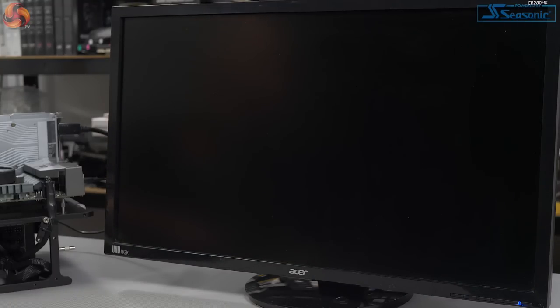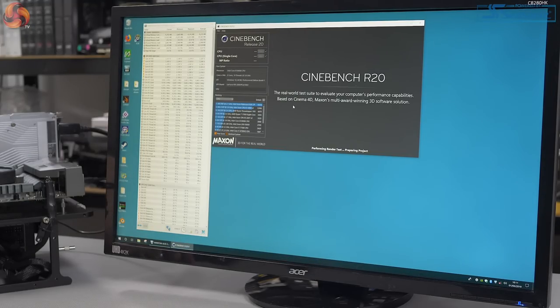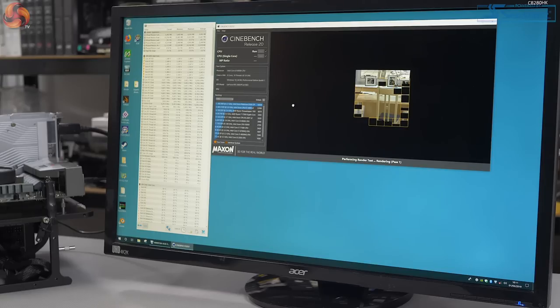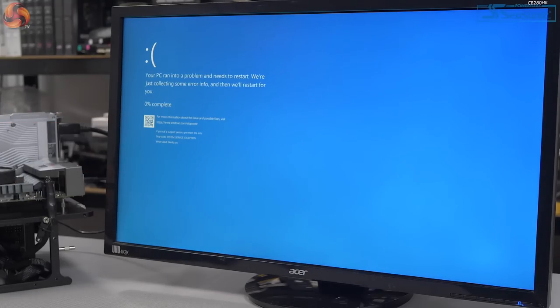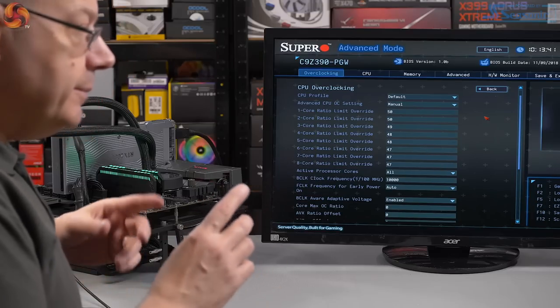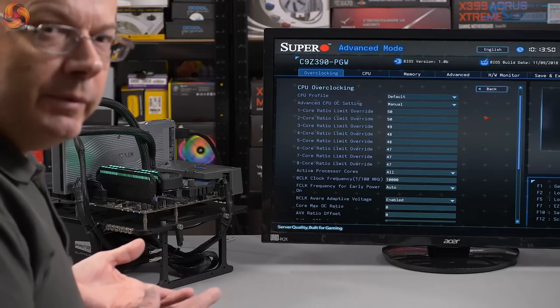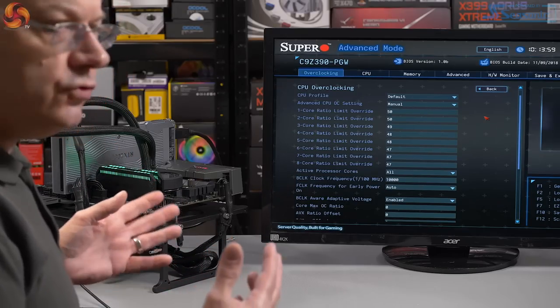Saving and rebooting — this is a very noisy motherboard with lots of beeping. Running the same test: initial turbo at 4.8 GHz drops to 4.7 GHz as expected, and then — blue screen. My rough-and-ready bump to 150 watts clearly did not work. Through experimentation I found that 150 watts is a bit cavalier; picking something like 125 watts is probably fine. In other words, give it more juice than 95 watts but not too much.